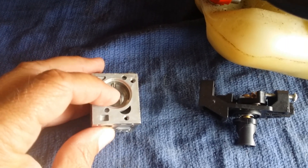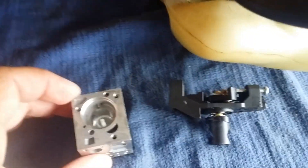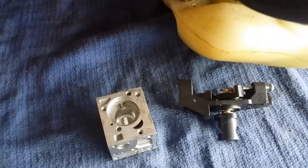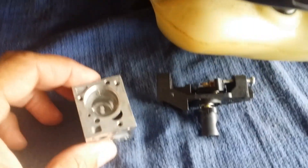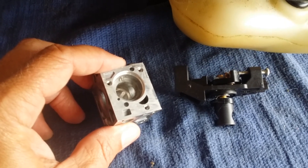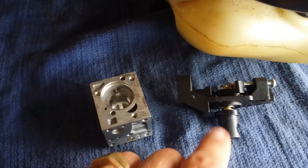When I ended up putting the roller back in the carb — the one that's actually on it now — it worked perfect. The only reason I'm posting this video is to warn you, as a couple other videos did that helped me out, is to make sure that roller gets put in there. I knew it was supposed to be in there, but I left it out because I was in a hurry just to see if it was running okay, and I forgot it was left out. It has to be in there.